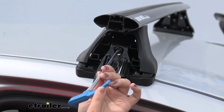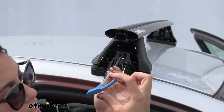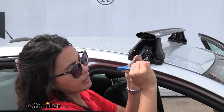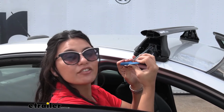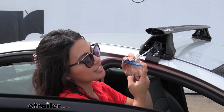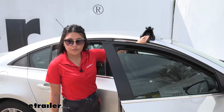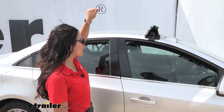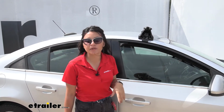We have this torque tool, and what that means is that as we turn this and you put weight on the end of that lever, once it flattens out, that's how you know you have enough tension in that bolt. So if you've double checked your measurements and you've installed it properly, then you can even slam your door on your hook, no problem at all.